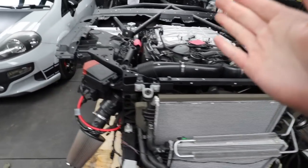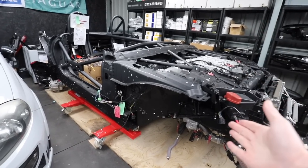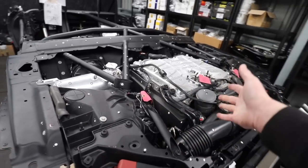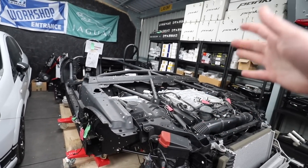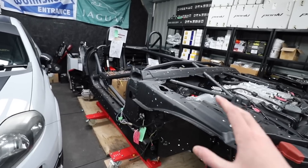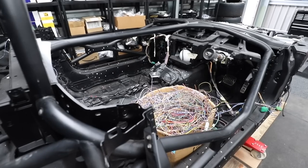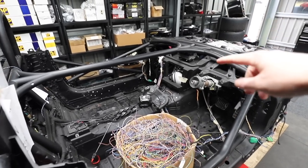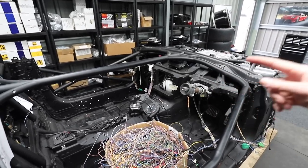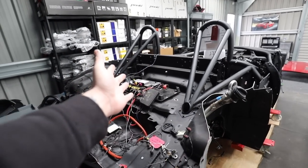How cool is this? So this is a one-off F-Type — it's an F-Type LM. This was built for the Le Mans race in 2014-ish, but it actually never ended up being completely finished and has ended up here. Engine-wise, it remains roughly the same, apart from with forged internals and a bigger supercharger, making somewhere between 650 and 700 horsepower. The body itself has been widened by 8 inches to make room for bigger, wider wheels and completely custom suspension with all new arms. The car isn't going to have a windscreen or a roof — it's going to be open top, so all the bugs will be going straight in your face. From here backwards, everything else is going to have to be custom because there is no F-Type with a back end like this.